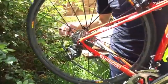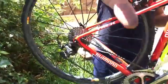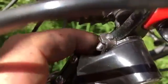Another little hack: I reverse the B screw around so the head of it is just sitting on your derailleur hanger tab. That works perfectly — when you've got the B screw limit in the 32 you're fine. This shifting is great and Di2 works perfectly as well.